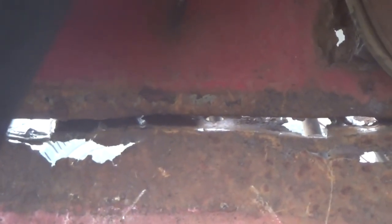And the hits just keep on coming. You see, I've got most of the cab mount tore loose from the pinch weld there, but as I was vibrating it, look here beside the steering column. The rust followed that cab mount and went right on up the steering column, or beside of it. So I'm gonna have to patch a piece in there. Oddly enough, it didn't rust the pinch weld out though. But it's right dead square in line with where the cab mount is. Yay me.